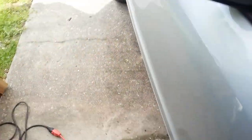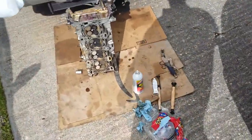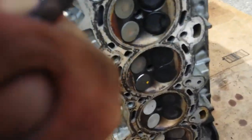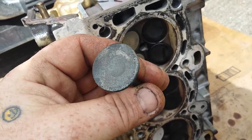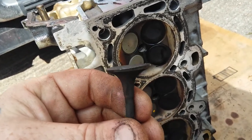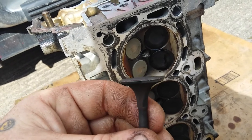Did all the timing work, marked everything. The car was showing a misfire on cylinder 2, so I replaced the coil — that didn't fix it. Turns out there's no compression; the valve is extremely worn and lopsided.